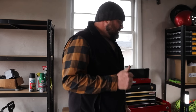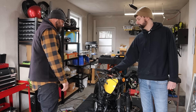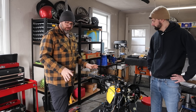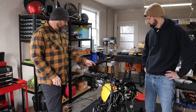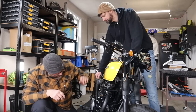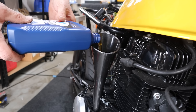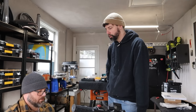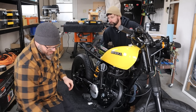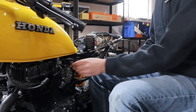All right, so we got a key. You got everything you needed? They didn't have half of what we needed but we got enough. What's missing is this bolt, which I can run to the hardware store. So here's where we're at — the wire harness is run, things are all hooked up in the right spots. We just need to hook up battery, positive, key. We want to put some oil in — it takes 2.6 quarts. There's probably no more than half a quart to nearly empty in there. The petcock's on, fuel line's on — is there fuel in? No. No more than we need to run it.